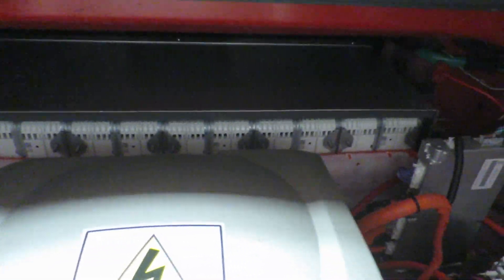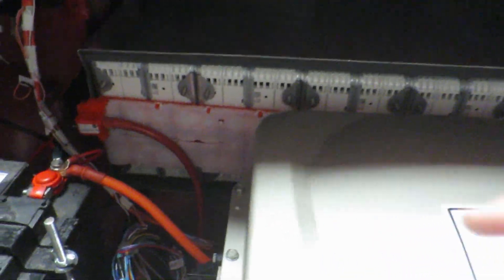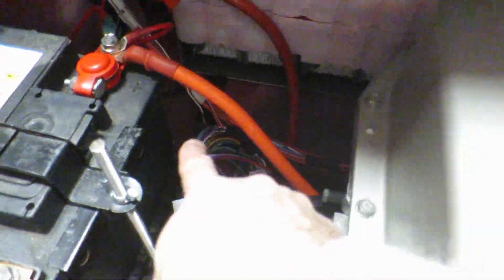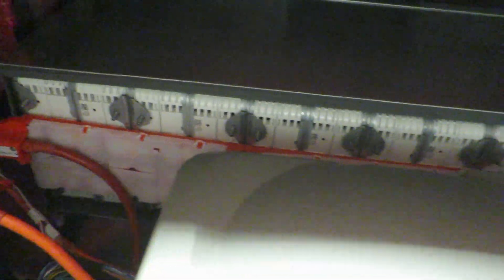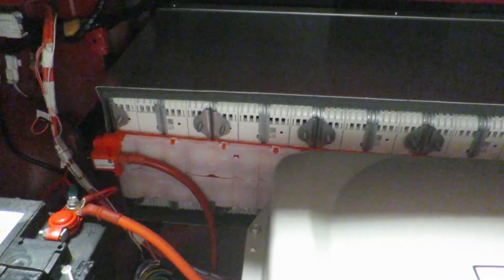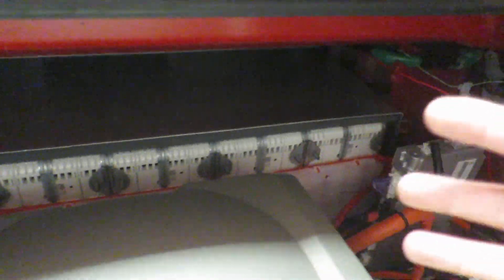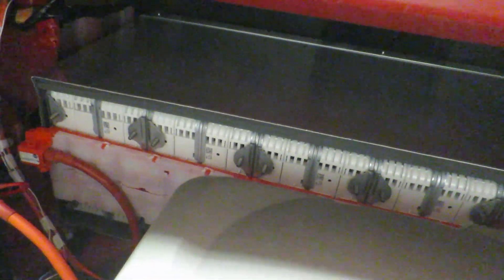In the back, my rear battery box isn't actually fixed in place — it's just sitting there. It's about 100 kilos so it doesn't move easily, but when you're driving it does move. I put a 3D-printed plastic brace in here, and there's an aluminium brace on the corner to stop it creeping forward under acceleration. But the other problem is that if you go over any bump at speed — say 50 mph — you can hear the pack actually jump. I don't really want to take the whole lot out again; it's an absolute nightmare with the rods going through to tighten it all up.